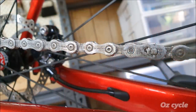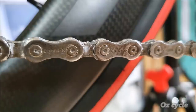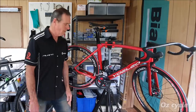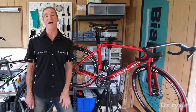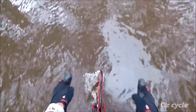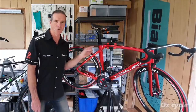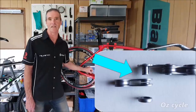Taking a closer look at the chain — it's no longer a shiny silver like it was brand new, but a dull silver. It has lots of grey patches where it's lost the factory anodizing and has the odd rust spots coming through. The cassette sprockets have also lost their sparkle but still retain good shape, which is important for efficient gear changing. It's definitely starting to look a bit second hand and dull. But it has been through three full winters — a chain is completely exposed to all the elements at all times. How would you feel after going around and around in all conditions for twelve and a half thousand kilometers? But the important thing is this chain is still going, which proves the wax is doing its job inside the links of the chain, despite looking dull on the outside.